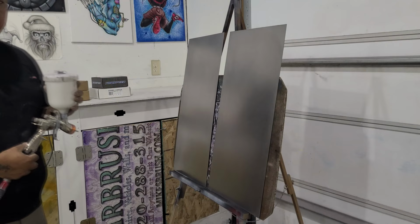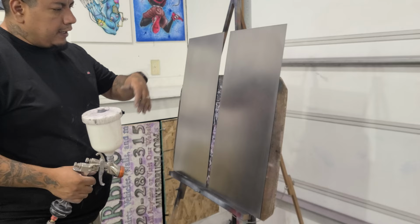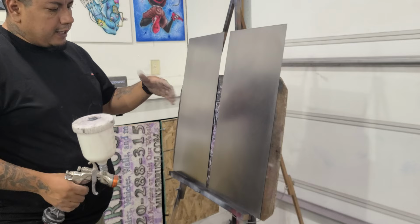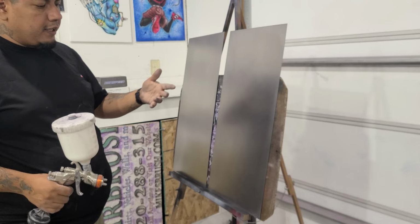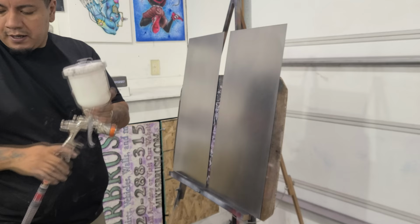All right, guys, so I got my spray gun out, and all I'm gonna do is give it about 2 or 3 good coats with the sealer on it. I'm gonna give it about 10 to 15 minutes in between coats to let the coat dry, and let it kind of air out a little bit before I go on and lay the next coat. Altogether this process is going to take about 45 minutes. So I'm going to put on my mask and everything, but put on the time lapse, because otherwise we'd be sitting here watching this video forever.